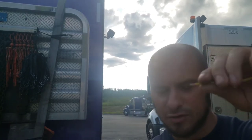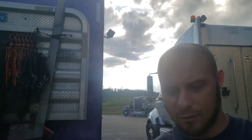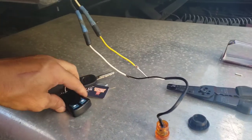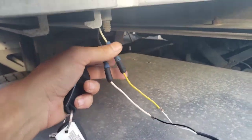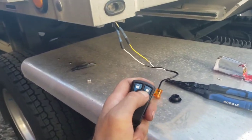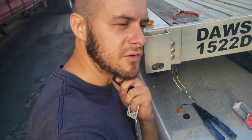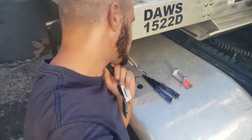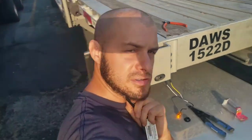You're just going to mash that into the butt connector — maybe since this is small I'll fold it in half. Put that in the butt connector, put the other side in the butt connector. Give it a little twirl. What I like to do before I put any butt connectors on is make sure that it works. So I got the plugs in there, just twisted the wires together. I push unlock and it lights all the lights up. If you put your unlock button underneath your chin it'll use your head as a satellite and you'll get better range. As you can see, it lights up — it's working great. Now let's throw some butts on there.